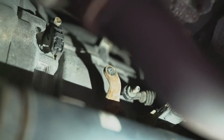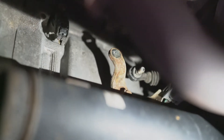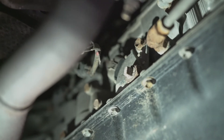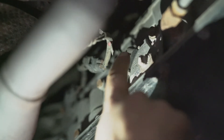What this tells us is that we've got an issue either internally inside the transmission, or if we come around to this side, we've got our neutral safety switch. That rod that goes through comes out to this side, and this sensor indicates what gear the transmission is in. So at this point we've narrowed it down to either something internal in the transmission or the neutral safety switch itself. The next thing we're going to do is remove it and see how it operates.